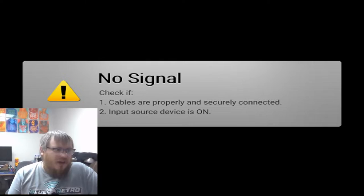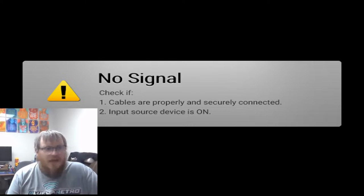The Blue Retro built-in VMUs will be a full-size regular VMU. That's a limitation of the VMU format, from what 8-Bit Mods is telling me. And there will be multiple VMUs available per controller slot. As of right now, we're still determining how much space we're going to have available on the ESP32, but we should be able to get more than four VMUs available to you per controller port.